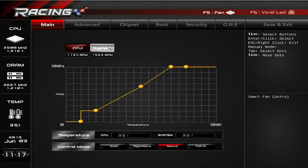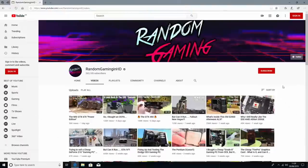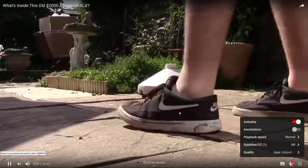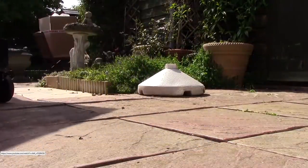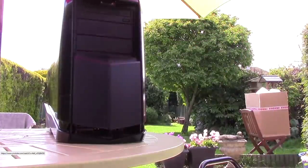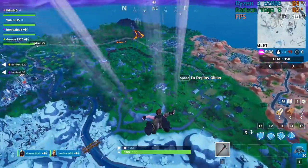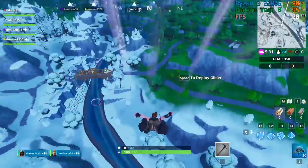Luckily, there's an option in the BIOS to set it to quiet mode, and it will adjust the fan curve accordingly, so if you're watching films or TV shows the system won't be audible in the slightest. When it comes to video playback in Full HD or 4K on this system, there is no problem — the 2200G handles all of that just fine. The Athlon 200GE is also a pretty decent choice if watching HD films is all you're doing, and the Ryzen 5 2400G is an option if you want more power, but I think the Ryzen 3 2200G is a nice middle ground — more power than the Athlon, and cheaper than the Ryzen 5, at least here in the UK.